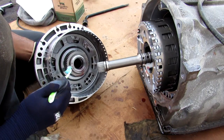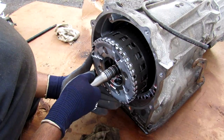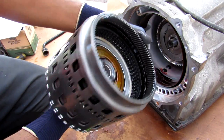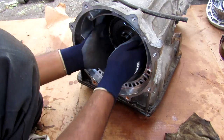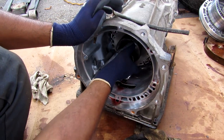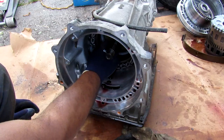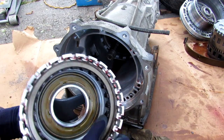It appears that the front sun gear assembly and this drum came apart with this transmission pump. Next up I'm going to remove the front carrier assembly — you can see it's got a set of clutches, and those clutches already look pretty black. Now I'll remove the band that goes around that drum. Next I'm going to remove the mid carrier assembly — holy, this is burnt up. Now removing the mid sun gear assembly, you can see there are burn marks on the outside. Now removing the high load reverse clutch assembly — these are pretty dark as well.